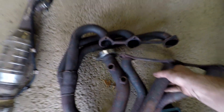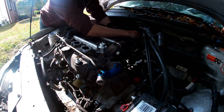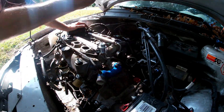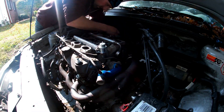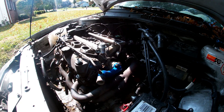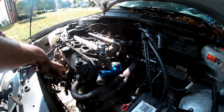Next is S&S. So this is a two-piece design. What we're going to do is slide the rear one down and behind, then get that front one on. This one's not too bad. I want to reiterate that when you're putting these together, loosely put everything together - get the back on, get the front on. Get that center connection - whether you have a v-band or the original donut gasket - get that settled, tighten down first, and then go back to the actual heads and tighten down the manifold.